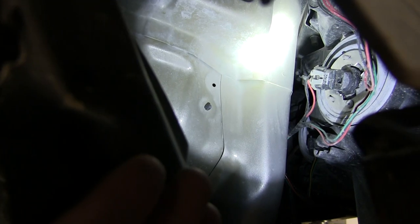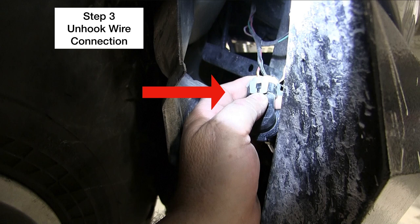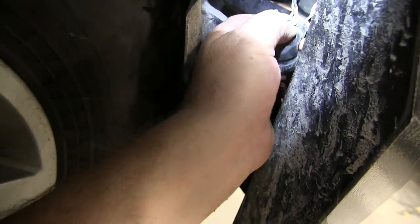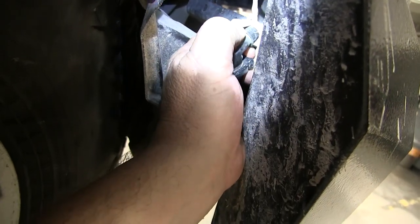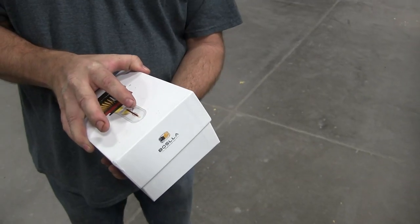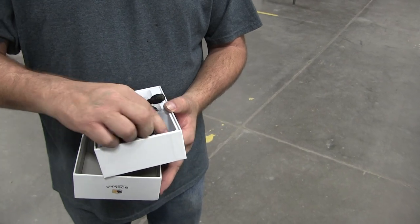Pull that liner back and locate the headlight in the headlight housing — it's a bit hard to get the camera in there. I had to use a flashlight for light. Reach your hand in, twist that out, and remove the bulb. There's a clip: lift up on the tab and pull the bulb out. With standard bulbs you don't want to touch the glass, but these are LED lights so that's not as big an issue.